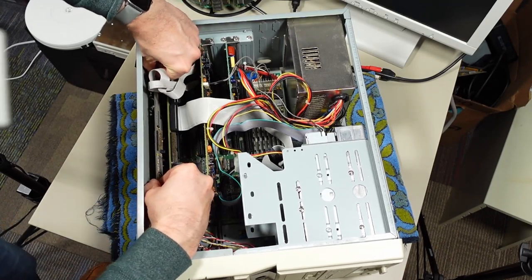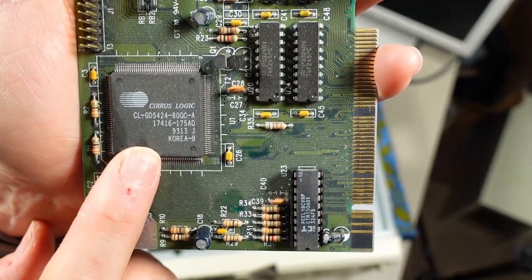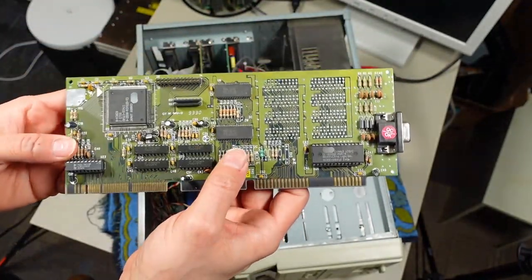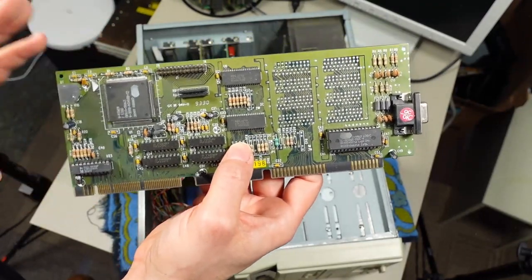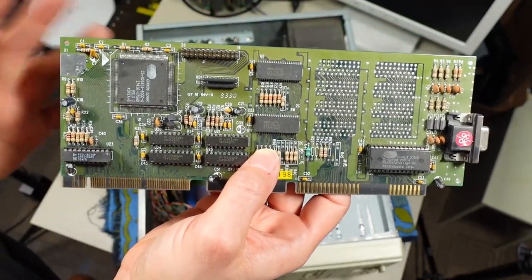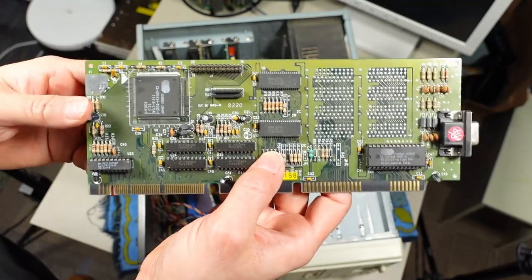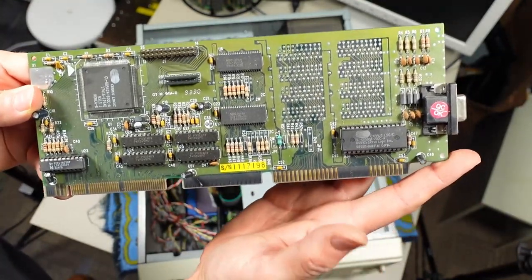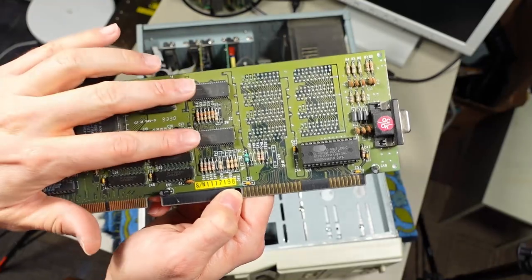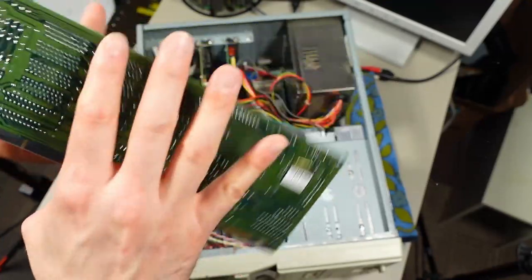Let's go through these cards. Starting at the bottom, this is the video card, and right away I can tell due to the length that this is a local bus video card. We have a Cirrus Logic GD5424 graphics processor. This is not a 3D accelerated card by any means, but it is a 2D accelerated card, meaning that once you install the video drivers, this thing is doing the blitter operations. Even at high color modes, scrolling in Windows is super fast — there's no slowdown, even when running in 256 colors or even 16-bit color. It doesn't appear to have a lot of RAM on it — just two RAM chips — so who knows how much this thing actually has.